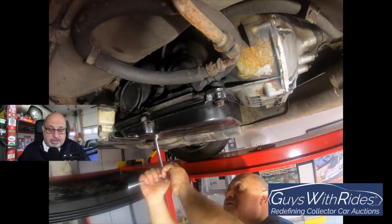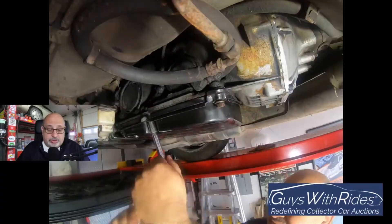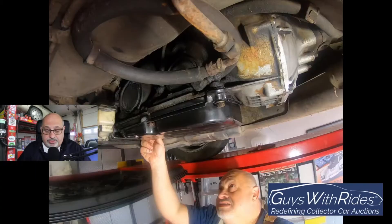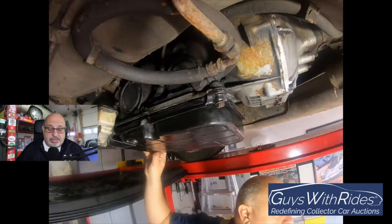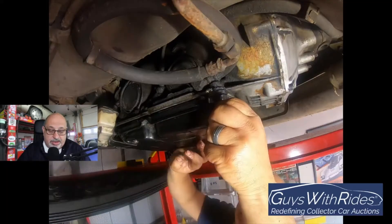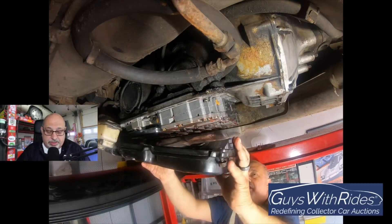Now it's a matter of six bolts. I slowly worked my way around because there was probably going to be fluid in there still, even though I drained as much as I could. I used a piece of scrap corrugated cardboard and marked it so I know the six hole positions for the bolts — I always prefer putting the old bolts back into the same holes. They've been in there 36 years, so it's better to put them in the same place. Sure enough, on the final bolt, transmission fluid came out — a couple of expletives there.